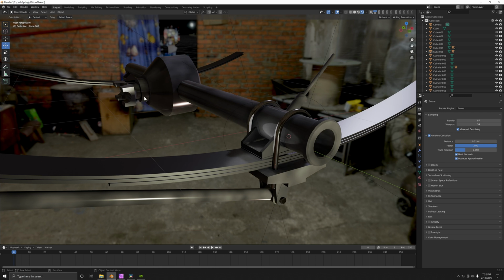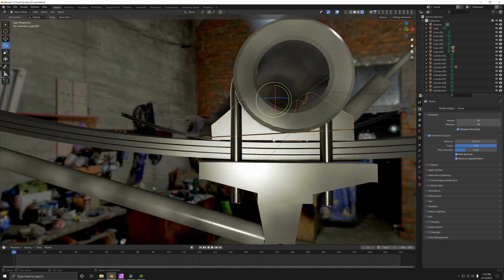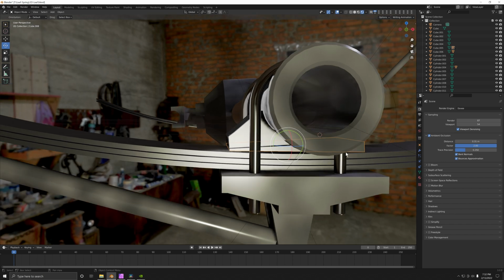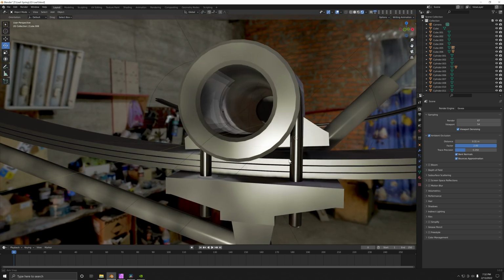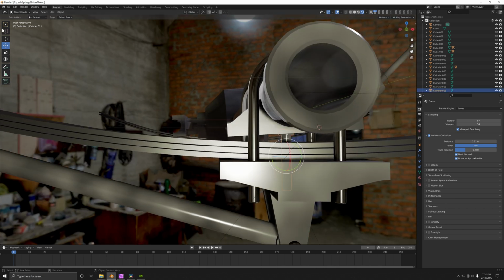So I first want to show you guys the shims in mine, because I got my truck with a 9-inch Ford and the guy welded these perches on. It had a horrible angle. So I'll show you where the angle was without these shims. I actually have more than one of these shims right here, so let me go ahead and just hide this real quick. All right, that shim is gone, right? And here's the bolt that goes into your perch. That is also very important. So let's go ahead and just slide this guy down real quick.